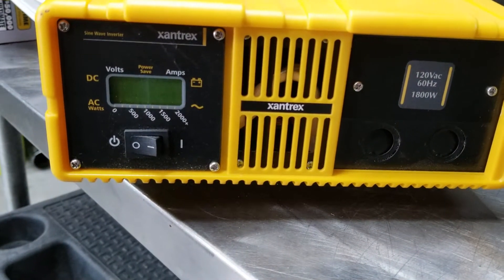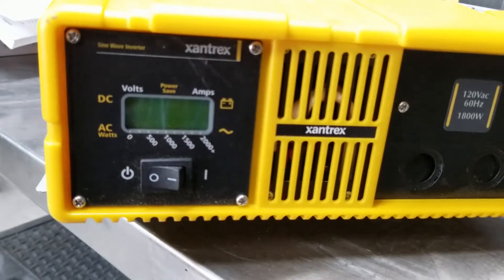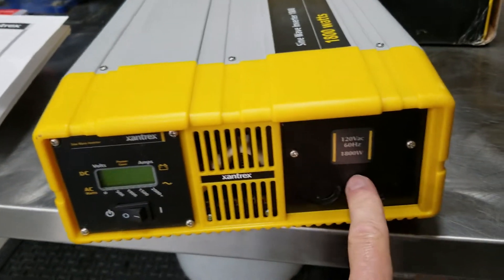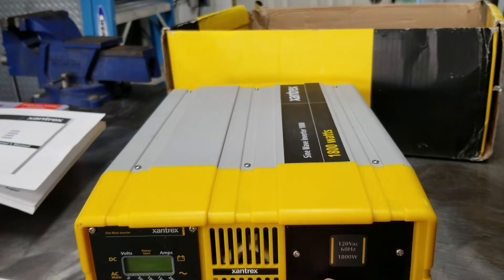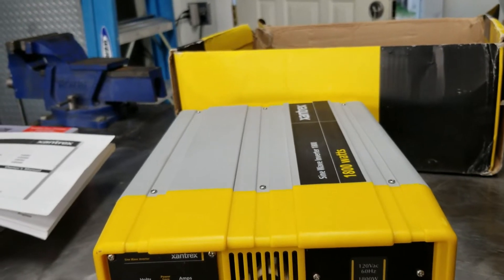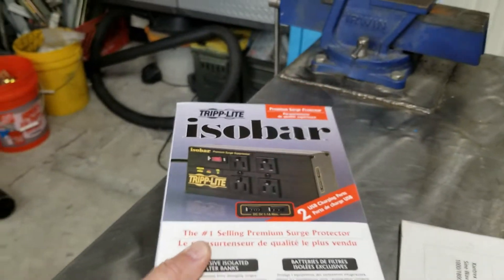This panel here is rotatable, so you can put it vertical, horizontal, or whichever direction you choose. There is also a remote mount kit that will extend this up to 30 feet away — I found that on eBay for $39, new old stock shipped. The cool thing about the hardwire version is that inside there is a transfer switch, so not only can you use this for an outlet, but you can plug shore power into it and it will transfer over to that power.